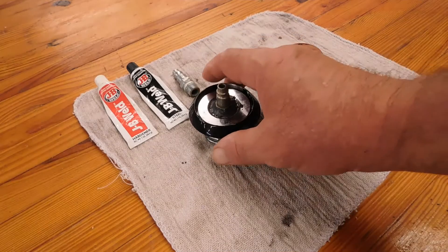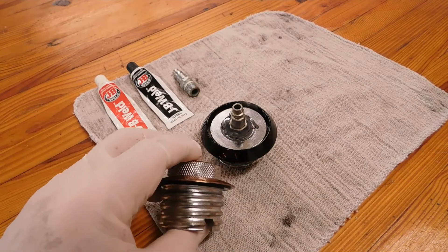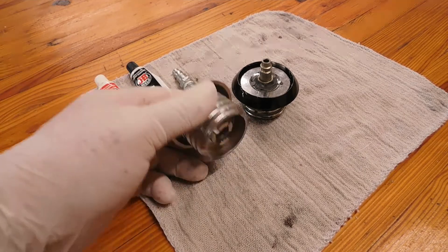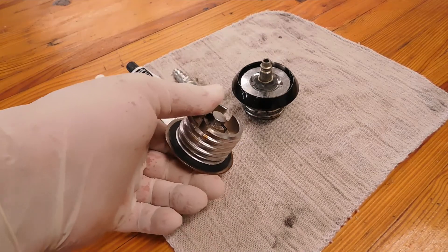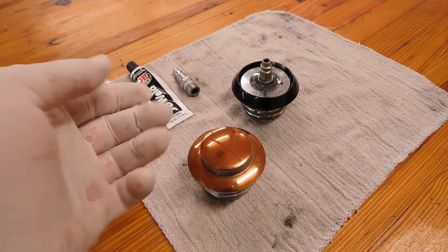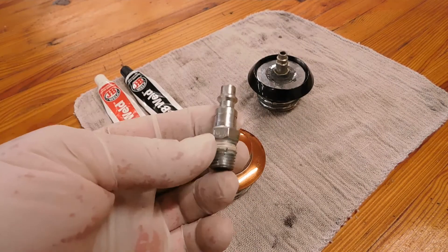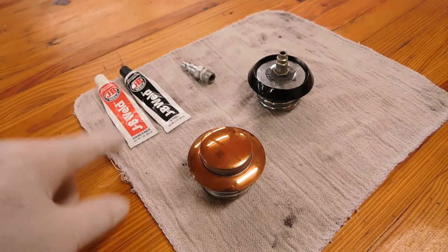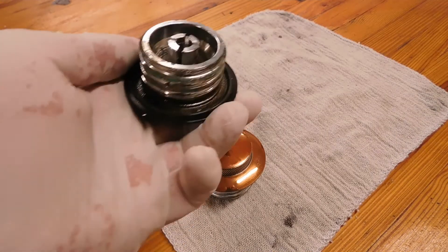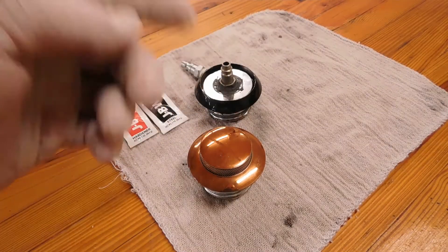The first thing you're going to want to do is make one of these right here. That's simply nothing more than a two-part pop-up gas cap. You can get these on eBay for around 20 bucks. All you do is pop a little roll pin out and this comes out, leaving you with just an empty hole. Then you get a male chuck air hose chuck and JB weld it in — that's it. These even have a little rubber gasket on the back side, which you leave in place. That's all you need to seal the top of the tank in order to hook the air hose up and pressurize it.